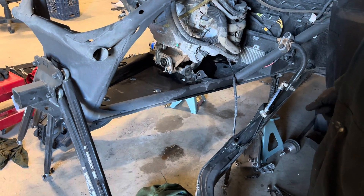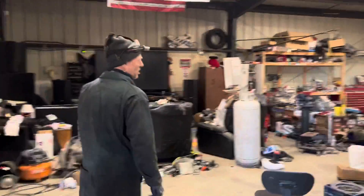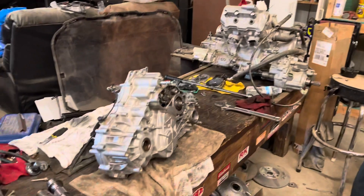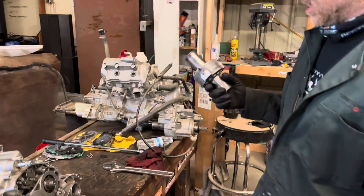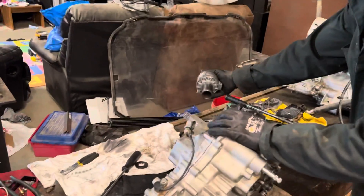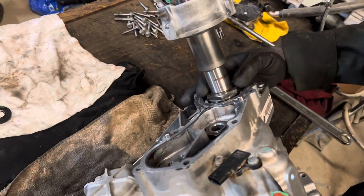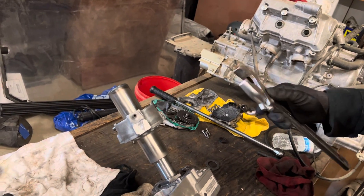I think they call it the sub-transmission — it came loose and just came right outside. If you're actually wanting to take the transmission apart, there is one special tool that I still haven't found the part number for, but I can tell you that you're going to have to have it. I had an extra secondary that fits over the input shaft into the transmission. There is a very large nut on there — I believe it's inch and three-quarter. I don't actually have a wrench that big, but I have a crescent wrench that I use to do that.